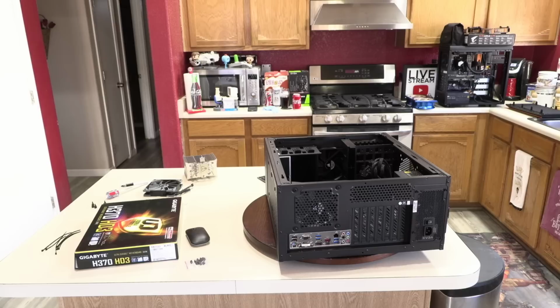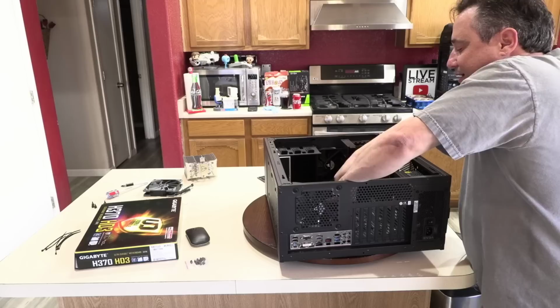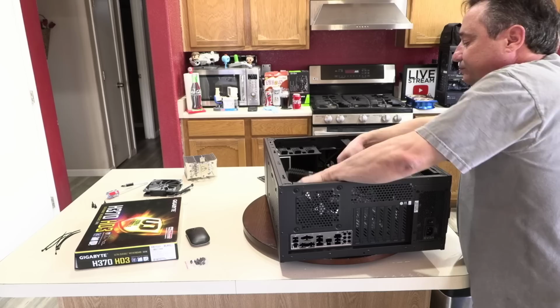Otherwise, they're going to sit in here for 10 more years. So, one at a time. I'll have to install a lot of these boards before I get rid of all of them, but one at a time, we will use one standoff. Again, only because I've got them hanging around. This is not required, but I'm going to place it into the unused hole that the case does not support on the motherboard, which is right here on the board.